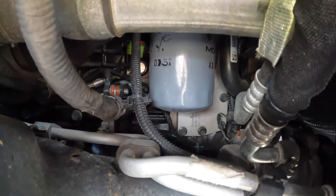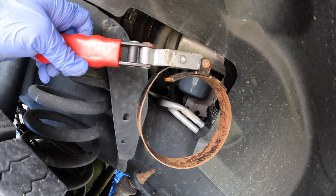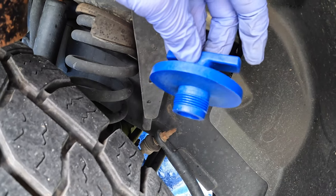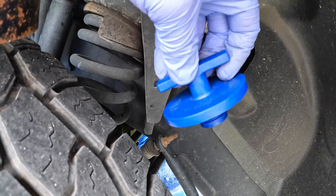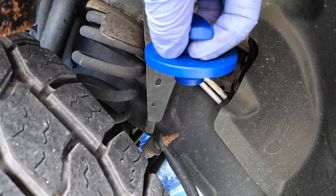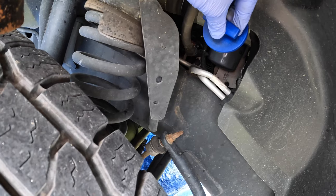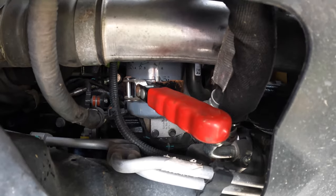You can access it on the passenger side real well. The tool I have to get it off is an adjustable wrench that goes around it and tightens up as you turn it. They also have a plug tool available on Amazon for the oil filter. That way, whenever you take it out and unscrew it, you leave it vertical, screw this in there, and you can tilt it to get it out of there, because you can't get it out straight. You've got to put it in and then turn it and pull it out. So I've got the tool in there, worked in. This tool is pretty nice for getting it out of here — there's not much room.